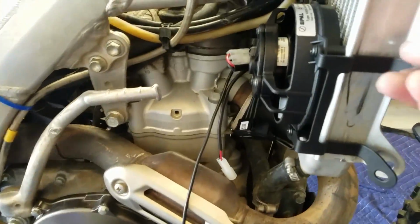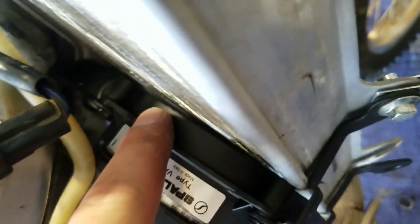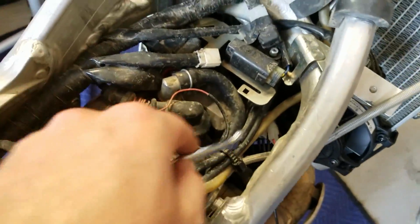After that, you gotta put this bolt in the upper arm. So after you tighten this one down, make sure you have 1 to 2 millimeters between there so the fan doesn't get messed up. And then it says to tighten that bolt that's back there from up top with a wrench, and that is an incredibly tight fit.